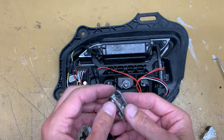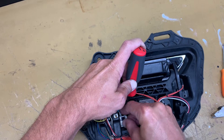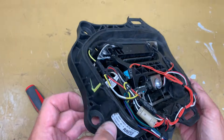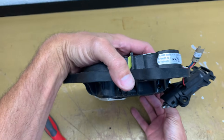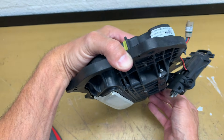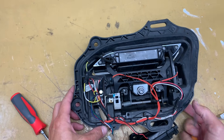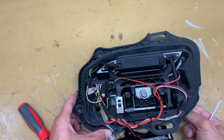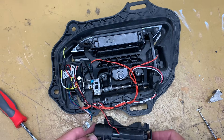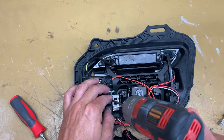This is the new paddle gear from us. You're going to use a small screwdriver to help guide the new paddle gear in. Basically, slide that shaft back through that paddle gear, pushing it so it aligns right there. So that way when you put that C-clip in, it holds that shaft in place and it doesn't end up sliding out.